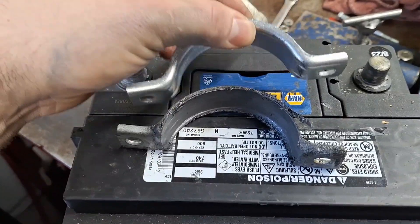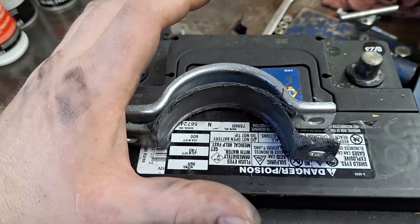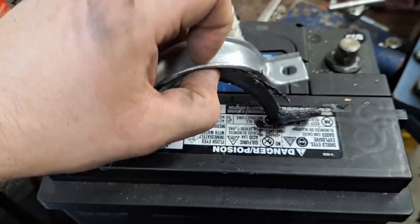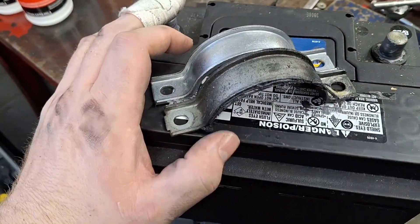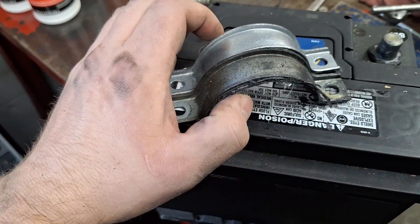Check the axle. Make sure nothing's damaged and do it before the transmission gets hurt. On a side note, I just want to mention on these transmissions, you should service them every 30,000 miles.